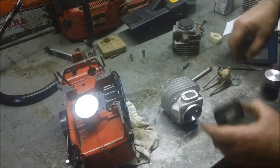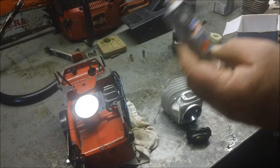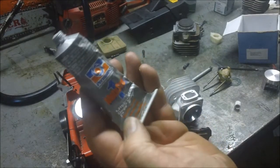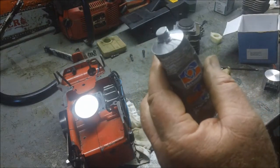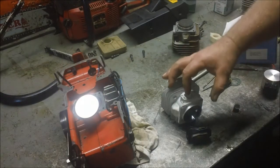Sometimes you've got to finagle that rubber dam a little bit, but it just makes things a little easier. So while I've got a video camera here, I might as well video some of this process. The focus of the video was just simply the squish — it wasn't all this other stuff. Gasket sealers: since it's hard to find my beloved 1194 and I'm kind of at the end, I've been trying different sealers. One of these is the Permatex MotoSeal 1 — they call it the ultimate gasket maker gray. I'm building a couple of saws using that material to see how it works compared to my favorites. I'm not recommending it — I'm testing it. I still recommend 1194, Yamabond, or one of those type sealers until something like this is proven to be worth endorsing. At this point it's just an experiment.